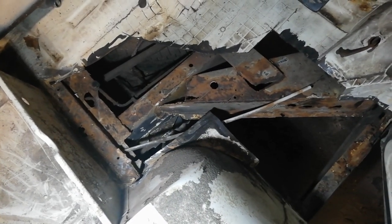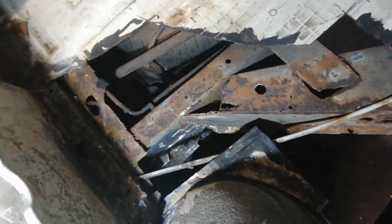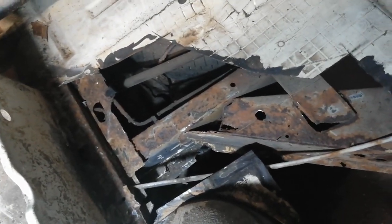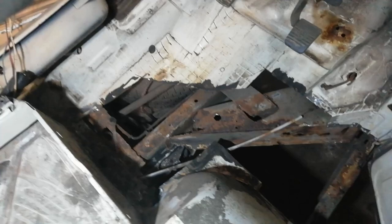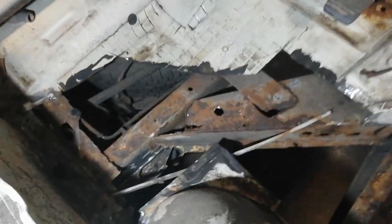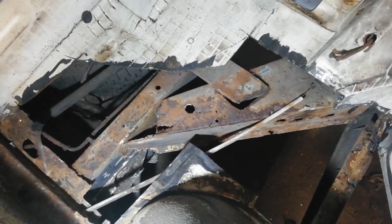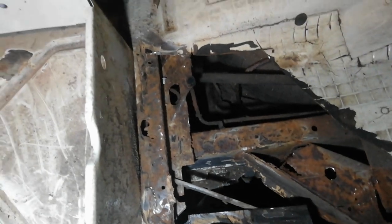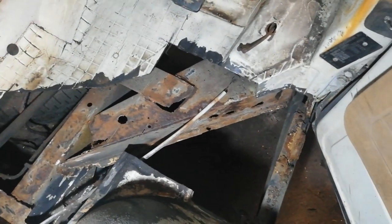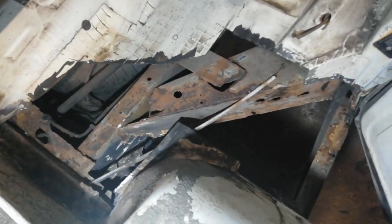A little bit of work on the top of that cross member. Rest actually is just the floor. Right, well, the reality of it really is it's just a bit of work on the top of that cross member, which seems to be the 1.2 mil steel. Chassis leg is fine in the heavier stuff there. Bit on that support there at the back, and then the rest is actually just the floor. Again, that's just sheet metal, so it's not really as big an issue as it looks. Well, I just don't want to think about it that much.